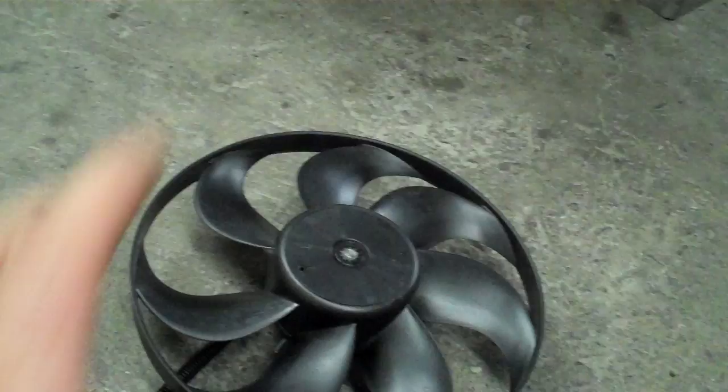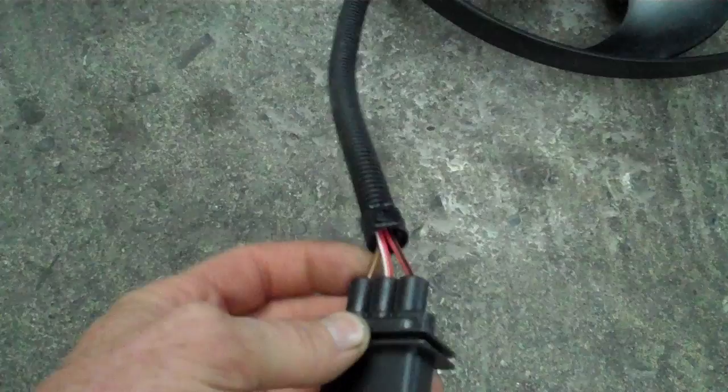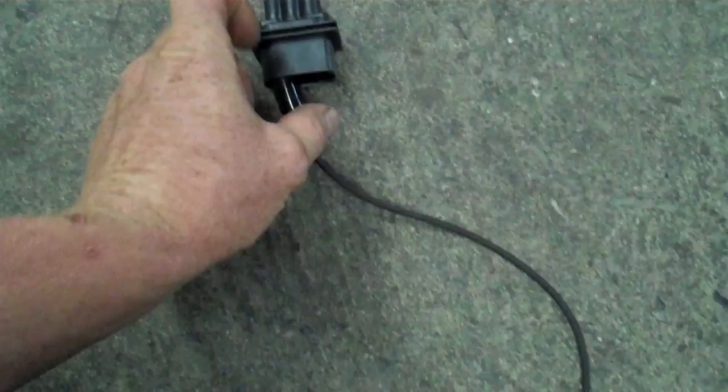This and testing horns and all that kind of stuff — you can just get it done. The brown wire is your ground. You've got brown, you've got red with a white stripe, and you've got red with a black stripe — or on the car it's actually black with a red stripe. With your power probe you can run power and ground to it directly. The ground wire is this one, this one's the low speed, and then this one's the high speed.